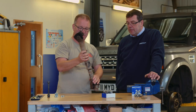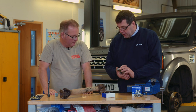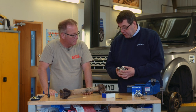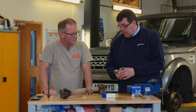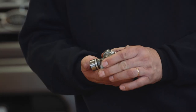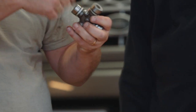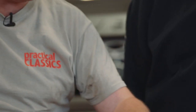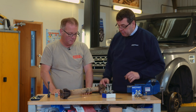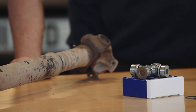How do we remedy this, Paul? Universal joints are readily available for this and all the Land Rover prop shafts, which we have in stock. It's a simple kit to install and completely rectifies the problem. You supply these with nipples as well. Regular greasing of the UJs and the slider on the prop shaft is essential to keep them going.